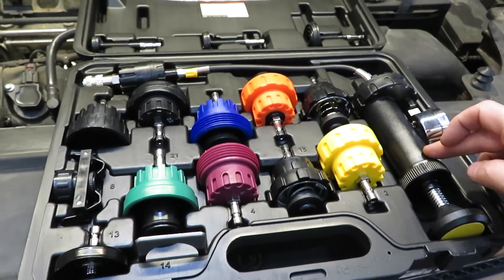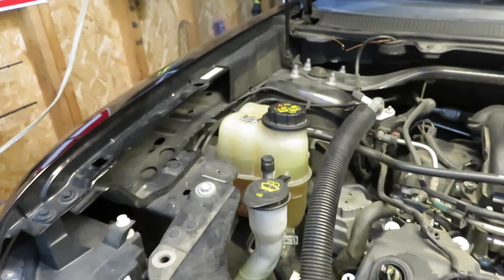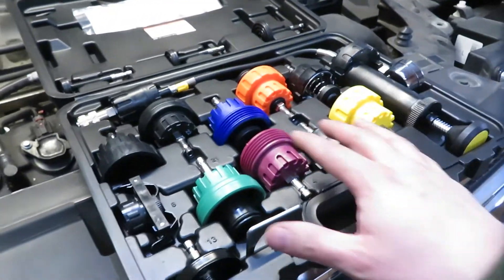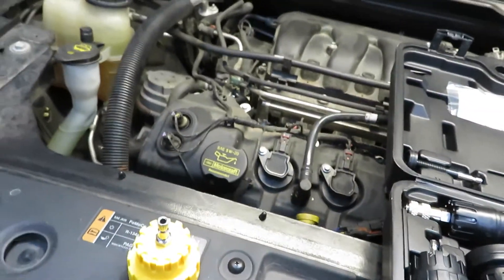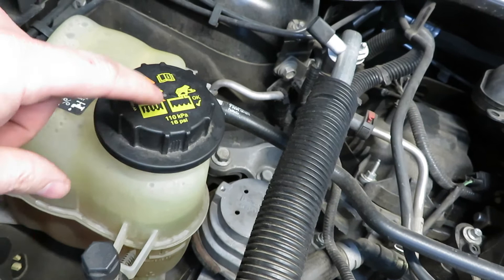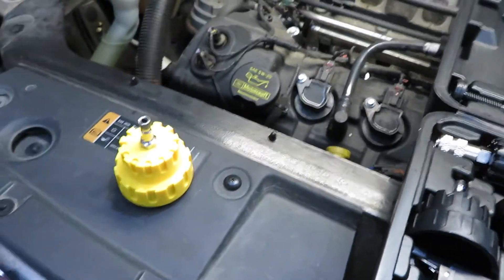In the kit we've got the air pump and different fittings to fit the cap, so whether you've got a radiator or a reservoir where you have to fill it, you should be able to use this. It comes with eight adapters and I already test-fit this one. I'll be using the yellow one. One thing we want to look at before we get going is what pressure the system is supposed to hold — that's what we're going to set the gauge to once we pump it up and get this cap on.